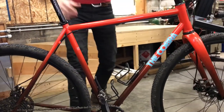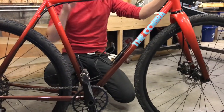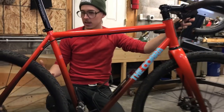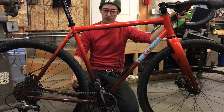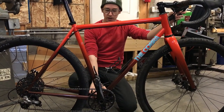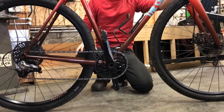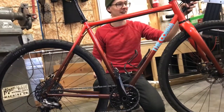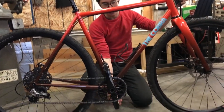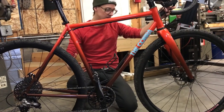One of the things I tried with this bike was — I was seeing from bigger companies that posted geometry specs, they would have kind of a high bottom bracket for a gravel or all-road bike. I was thinking, if it's really primarily a road bike and you might ride it on gravel roads or some light trails, you're not log-hopping all the time. So you want to push the bottom bracket down as low as you can so you have a lower center of gravity. I tried a lower bottom bracket height, and then pretty quickly I was riding this on mountain bike trails and wishing I had made a mountain bike — the cranks were getting hung up on everything. But if you're actually riding a lot on the roads, it'd be valuable to lower it down some so it handles and corners a little bit better.